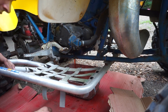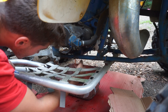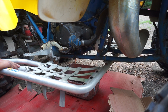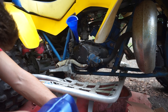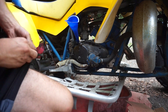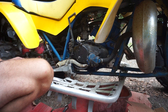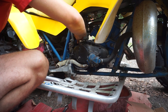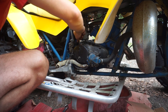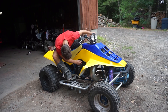The oil looks new — looks brand new. It's red, which is interesting. I wonder what kind of engine oil he was using in there, but that's a very good sign. Looks like a good amount is coming out. From what I read it's 1000 milliliters. Alright guys, I think it's time. We have coolant, we have gas mixed at 32 to 1, we just changed our transmission oil, cleaned the carb, cleaned the air box, checked the reeds, and the petcock's working. Let's try this thing!